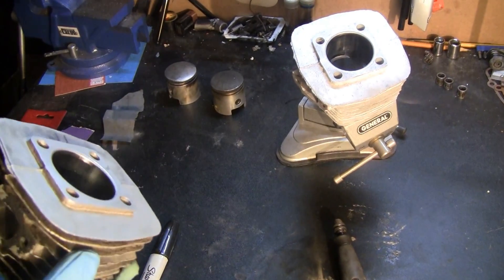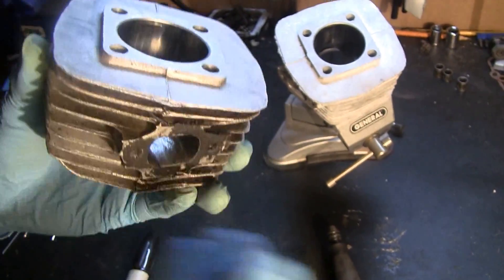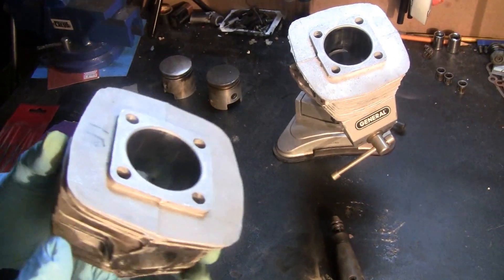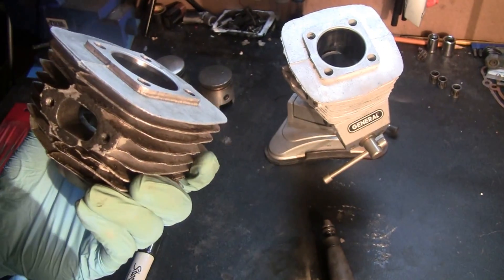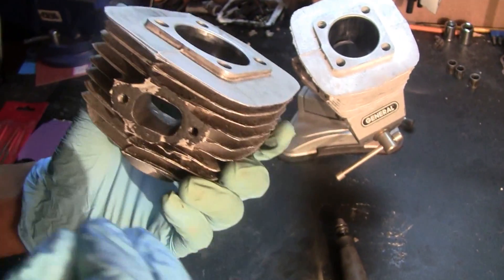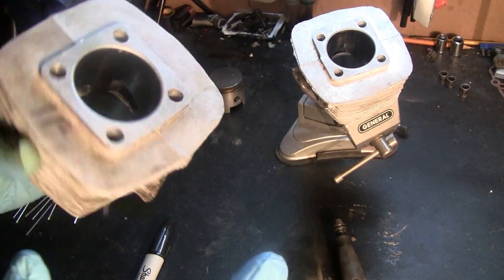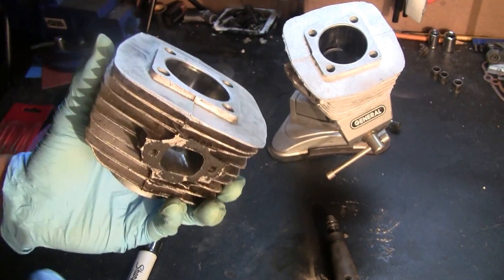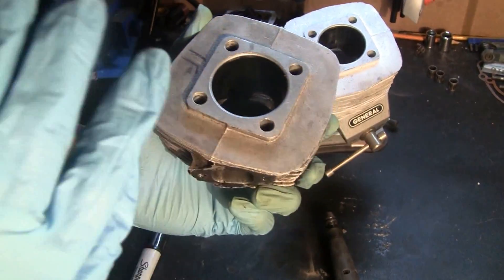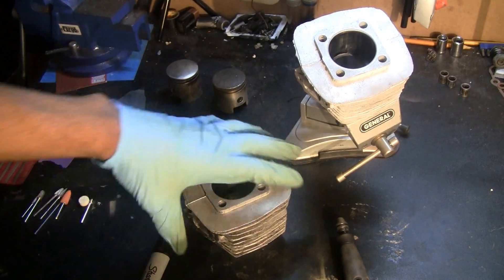We're going to go into a few aspects of porting. In particular, I'm going to talk about the exhaust port. The exhaust port is the highest port along the cylinder wall, responsible for letting the exhaust gases escape. According to Gordon Jennings' two-stroke tuner's manual — a pretty legitimate resource — when you round out the corners of the exhaust port, this usually helps a lot with getting the exhaust gases out, because in a two-stroke engine, the better you control the flow characteristics of intake and exhaust gases, the stronger your engine runs.